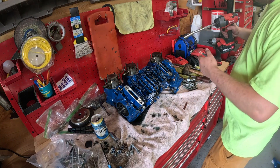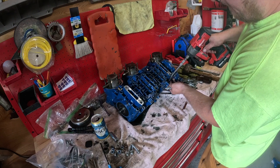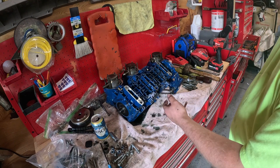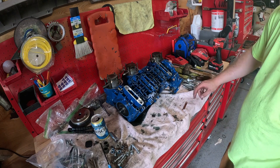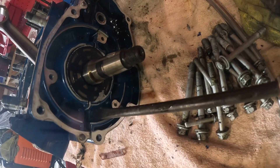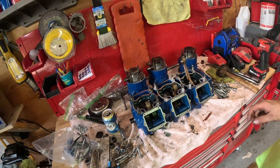It was a good thing checking this over before I tried to split it - there are more bolts on this bottom side. 100% my fault. One other thing - there is a drain right here, I could have drained all that oil out of the crankcase, but now it's on my workbench - not thinking. There's a 10 millimeter right here on the back side of that starter that's got to come out too. On the mag side, put a screwdriver right here, rolled it a little bit on both sides - didn't go crazy, it's just aluminum - and there you go, the case should be split now.